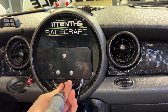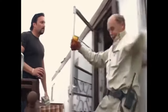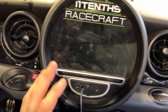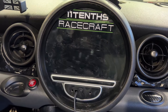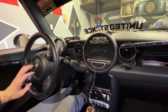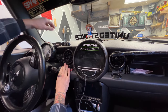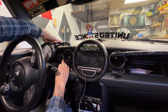To get this out, there are screws holding this plastic piece. There's the radio delete piece I was talking about — you can see I just wrapped it. Now I'm going to take this part out so you can see how it's secured in the speedometer. First, drop the steering wheel and take this off to get the speedometer out. You need to unscrew here and here — there are T20 screws — and remove this trim piece, and also remove the RPM gauge because it'll stop you from taking this fully out.